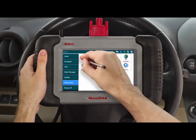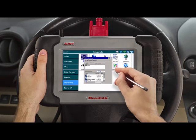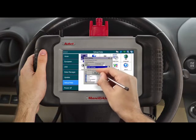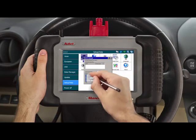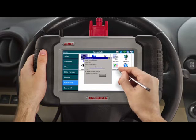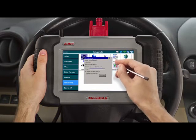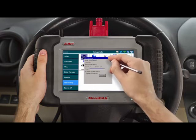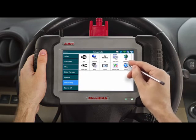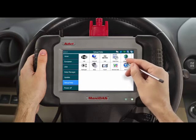The first icon on the left is the Wi-Fi configuration. Click on it and you'll go directly to the WLAN settings where you'll be able to log on to your wireless network. Delete any networks already listed in the preferred networks box by pressing on the network until a small option box opens and hit delete. After you've deleted these networks, select a network of your choice in the active networks box. If you're using a secured network, you'll be prompted for a password. Simply type the password on the keyboard provided and hit OK. If the bottom LED light next to the wireless symbol is green, and the icon next to the Internet Explorer icon at the top right of the screen is green as well, you're connected to the Internet.